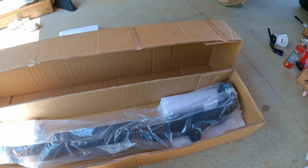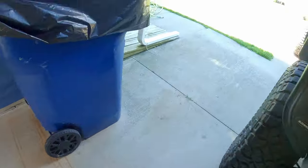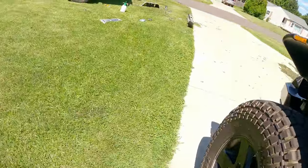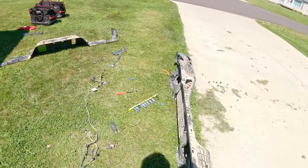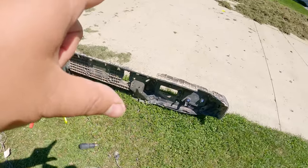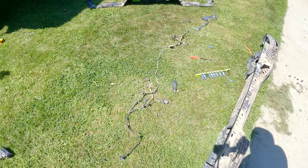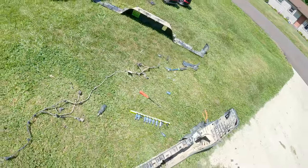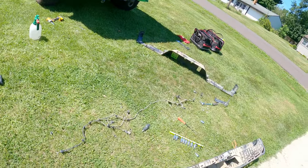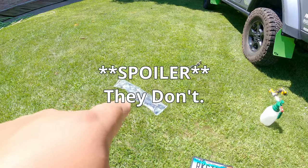We have to move the sensors over into this new bumper. I've taken out all of them except for the one that's in the basement that I took out before. You have to pretty much take off the top layer, then reach in and kind of pry back each of these clips so that you can push back the piece — they're attached to the harness. Normal people would get to reuse their harness, but I cannot, so I have a new harness to put in.